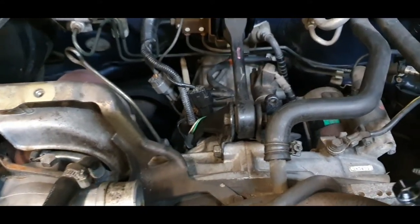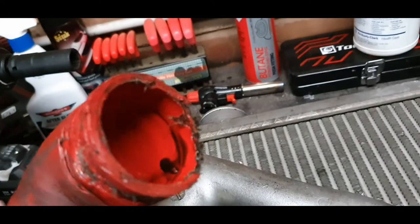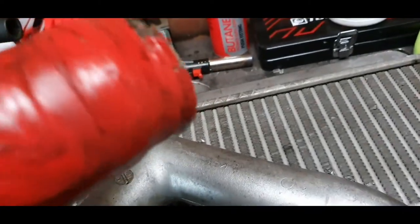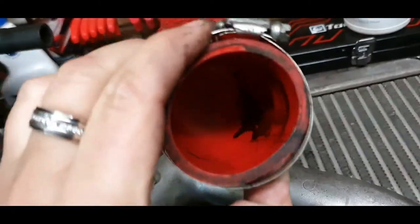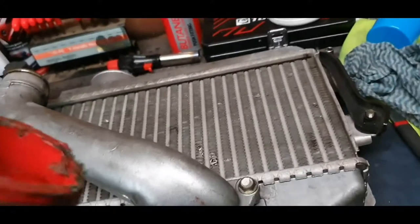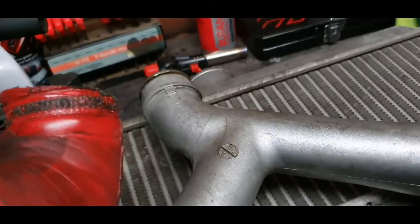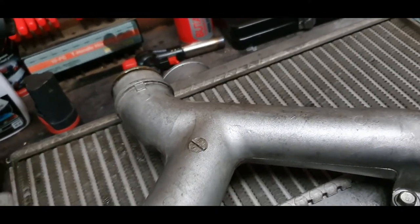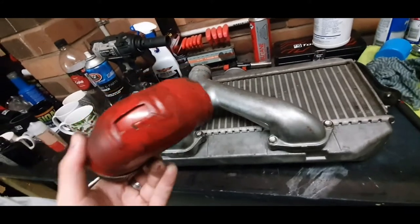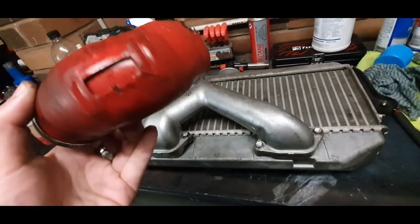On the bench — that is why I was changing the pipe. I don't know what brand this pipe is, but there is oil in it and it hasn't been cleaned since I've had the car. What you do is wipe down all the flanges with brake parts cleaner, wipe down the hole, and clean the intercooler. Even better, there's a trick where you fill it with fuel, let it sit until it's clean, then flush it fully and let it dry.